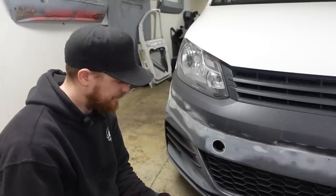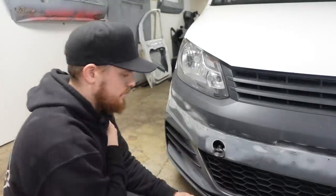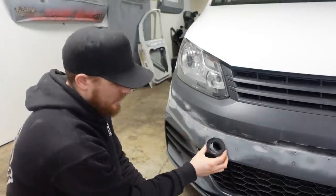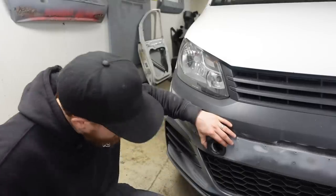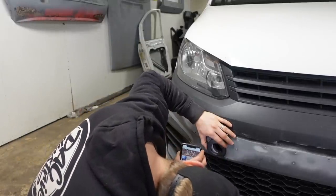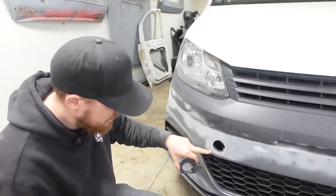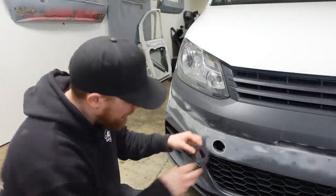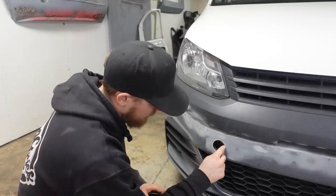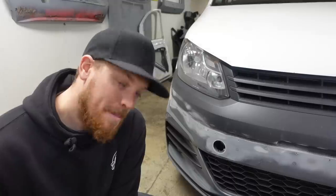What we're going to do next is move this towing eye. When you put the towing eye in it's on an angle and won't do up because it's in the wrong place - it needs to come down here somewhere. I cut this one out of the old bumper. It looks as though it'll work - we want the bottom of this to be about at the bottom of the swage line in the bumper and we want to bring it over to somewhere near there. First thing we'll do is cut really tight to this, cut this hole out, then start nibbling away a little bit more at the sides to get the size right.